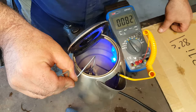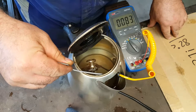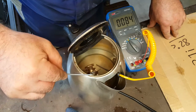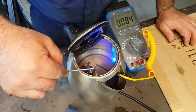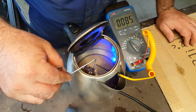81, 81, 82 degrees. We'll turn that off for a second — I think we're still warming up, I want it to maintain that temperature for a bit. Has it opened? That's the question. Nope, it hasn't opened yet. So we'll turn the kettle back on and see what temperature we get to before it actually activates. It should be open now — 82 degrees is the temperature it should open at, and it hasn't opened.